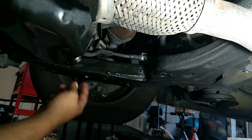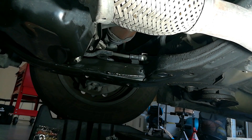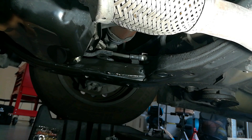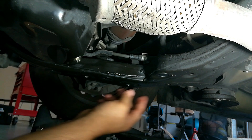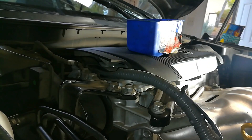Before I get all my tools out — the drain plug is snug, the oil filter housing is snug. Everything else around the vehicle I can do a quick inspection. There was a little bit of an oil leak as you can see — that was from the oil filter housing seal, and I went ahead and replaced that already. Go ahead and check anything else out while you're underneath there. The drain plug is back in, the oil filter is back in, and everything is nice and tight.